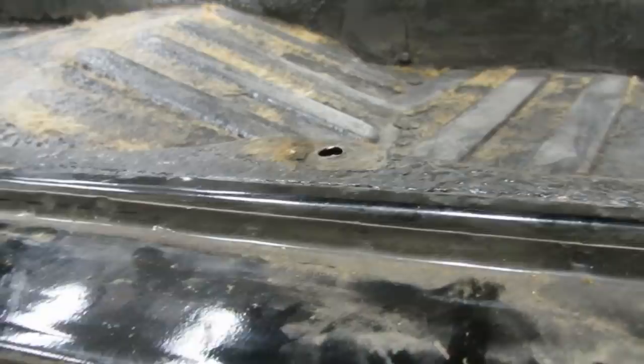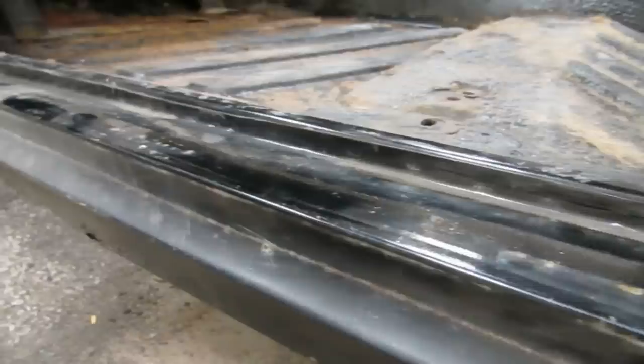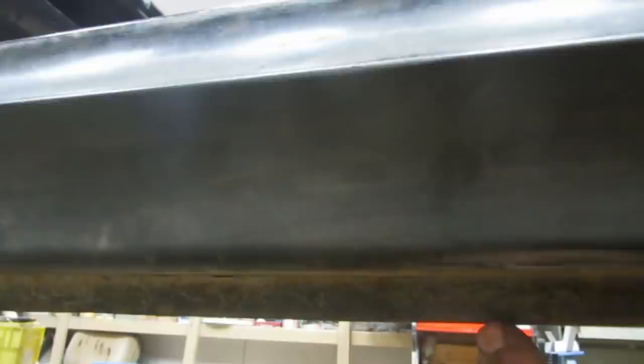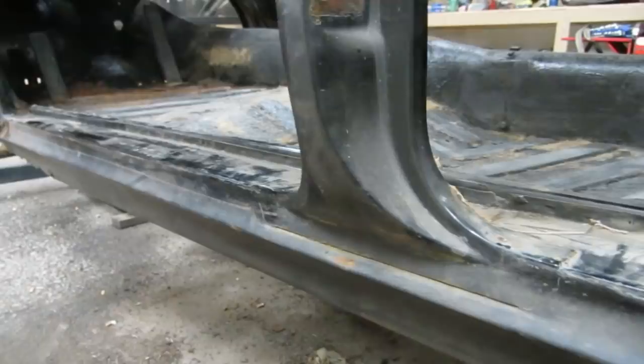I'm going to start by center punching all of these welds. There's quite a few. They look to be about every inch and a quarter. That's not bad. I've done this type of work on an E-type Jag, and they're almost touching each other. There's so many. So this is not too bad. And we'll do that there. Section around the posts, and then drill out all the spots on the bottom flange, which we can see here. So same thing, every inch or so down there. I'm just going to settle in here with my center punch and my drill, and we're going to take all these apart.